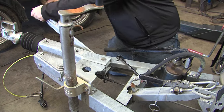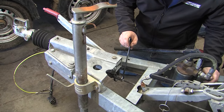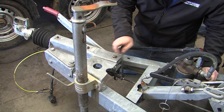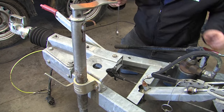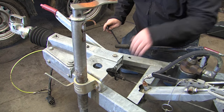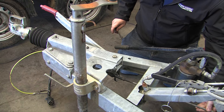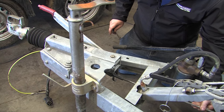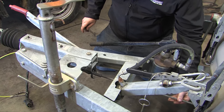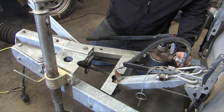To do that, lower the handbrake down, loosen the locking nut on the brake rod, and turn the rod into the handbrake. Then reapply the brakes.